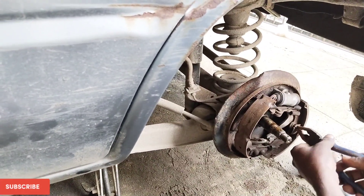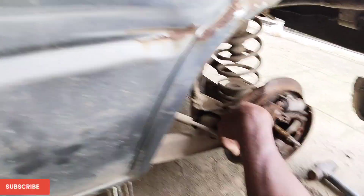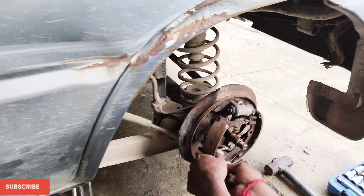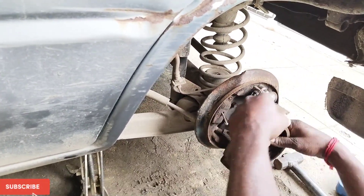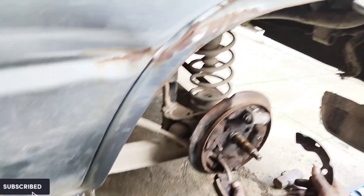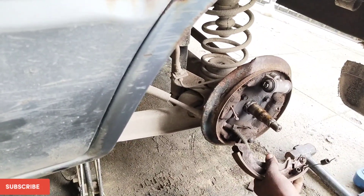Similarly on that side: press and twist, and with this the brake pad comes out. It's a simple method — just pull out, then we have to remove the springs one by one. So now the brake pad came out. Next we have to remove the handbrake wire that is linked to it. First, we will separate the two brake pads by removing the three springs.